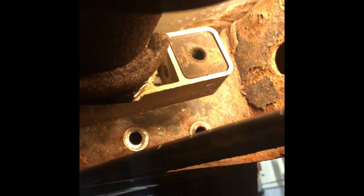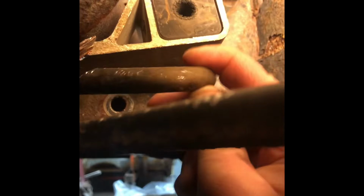So here is chapter 12, section 3.9, whatever. This is, I know, more than engineers at GM. So, the transmission mount, can't really see. You can see it if I just point the camera right. Goes up into this little crevasse up here, and it's got a little bracket to hold up the exhaust. Well, you can't much do hardly anything without this little piece right here, finagling it and trying to bust that through there, try to get through that little hole. Because if you get in here, let me get right in there, you can see how tight it is. It don't work that well. So you know what I did? I just zip that little thing off, and here we go.